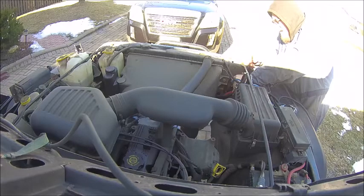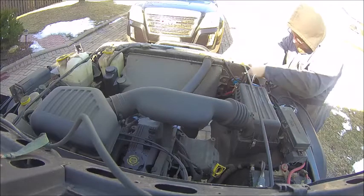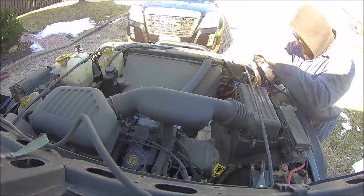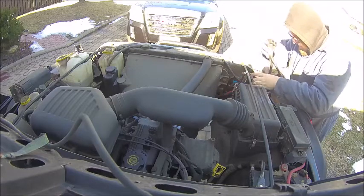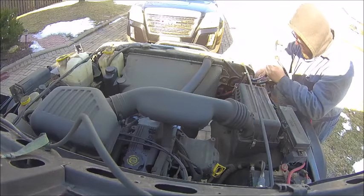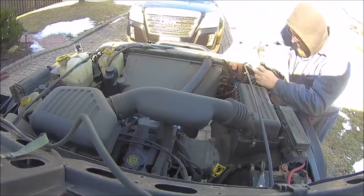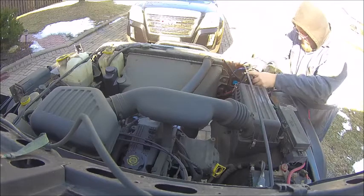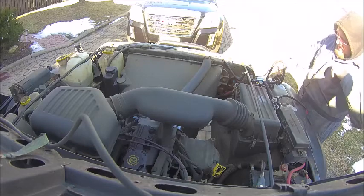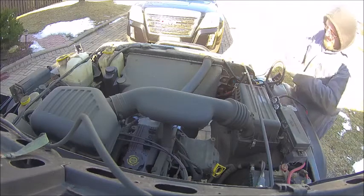That's actually what came with the harness, running out, so both lights are being fed by less than 30 amps, which is probably still better than the little tiny wires that are coming out of the switch. And the bigger the wire, the more power that they can draw. And because it's coming straight off of the battery into the lights, you're saving a lot of resistance there, which means that the lights are going to be brighter. That's the theory behind it.